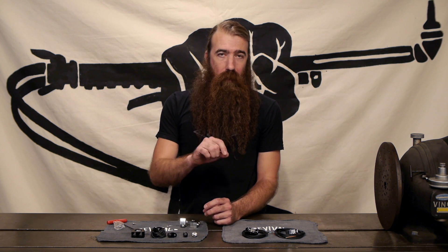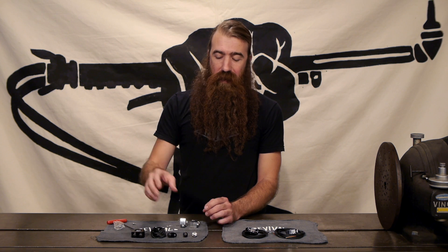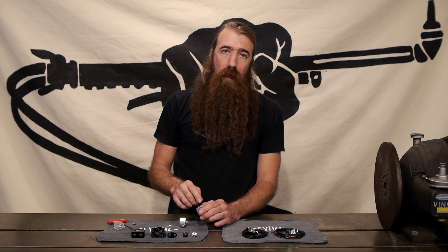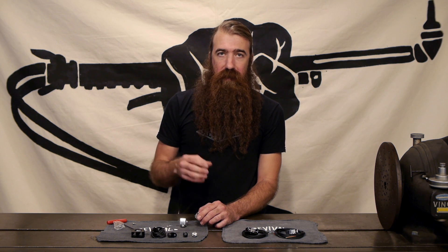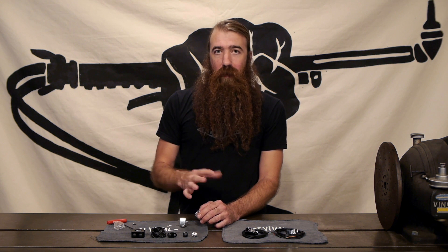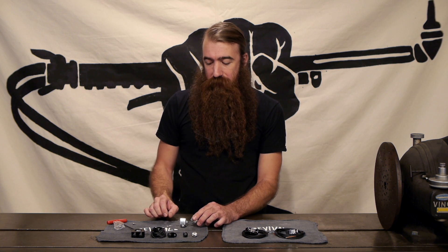So when I do a wiring job, I always run a wire all the way from ground up through into the handlebars and all the way to the switch — one wire into the bars. And from there, that's where I'll splice out into however many wires I need, whether that's four, five, or six, to address each switch individually.